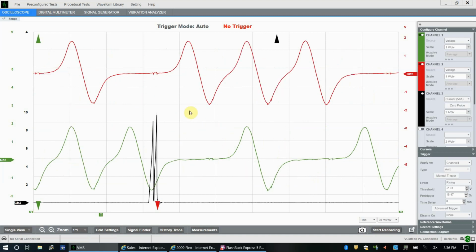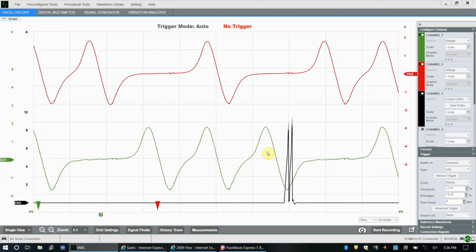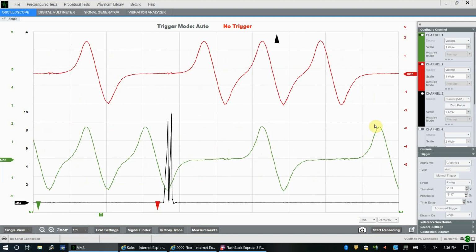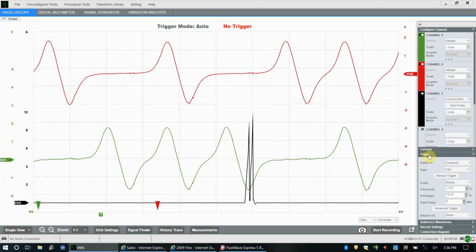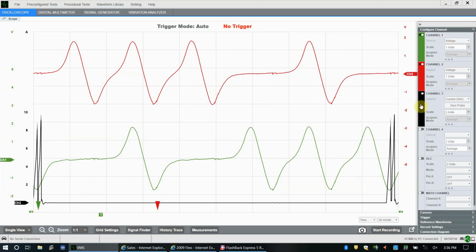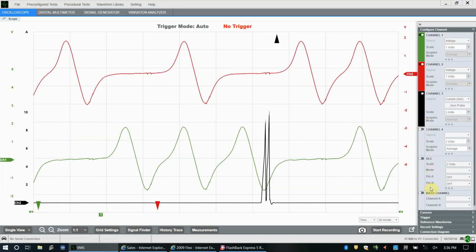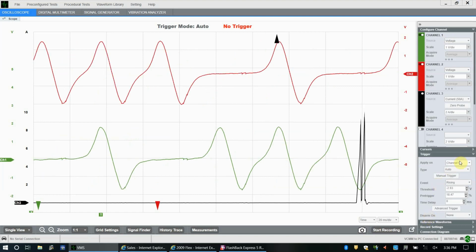So if you trigger on that event, you can print a very nice pattern on the screen that's going to reprint itself over and over again and let you watch the other signals for anything that's happening. So how you do that is very simple in VCMM. It's very simple in most oscilloscopes, I should say. So you have this pattern here on the right, this configured channel. What we'd want to do is pull up the trigger.